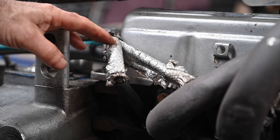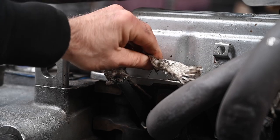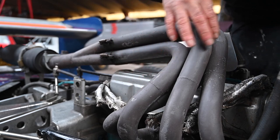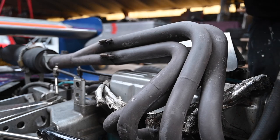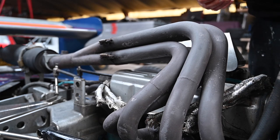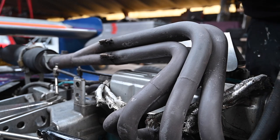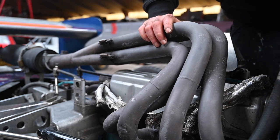It still looks in fairly good condition but a bit tacky. Have a look at the exhaust header — all the pipes are curved to roughly the same length, and there's a very good reason: you want an exhaust that is minimally restrictive, so the gases all have the same trajectory through the pipes. At high RPM that flow creates a suction effect on the inlet, especially with a 300-degree camshaft or more. The headers look pretty good, so nothing to do there for now.